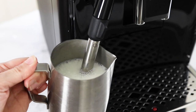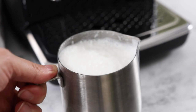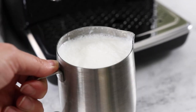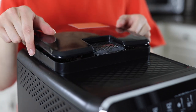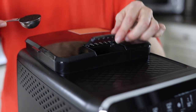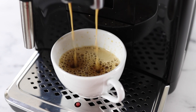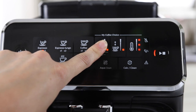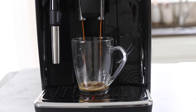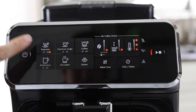The milk frother included will let you make a cappuccino or latte but it does not include a milk pitcher, so you'll be responsible for buying that. What I like about this machine is that it includes a bypass option for using ground coffee, so you don't have to clean out all the beans you already loaded if you want to brew a specialty coffee or a cup of decaf in the afternoon. To use the bypass feature you'll need to hold the coffee button for three seconds to make it switch over, and be sure to select a single espresso shot or the bypass feature won't work.